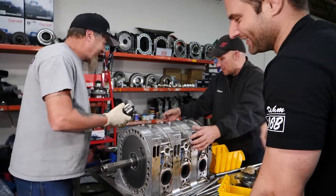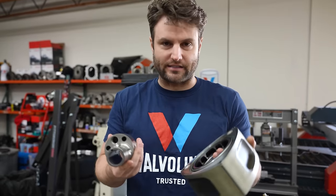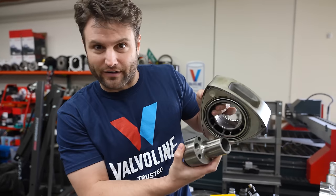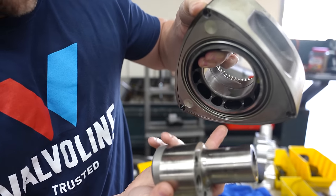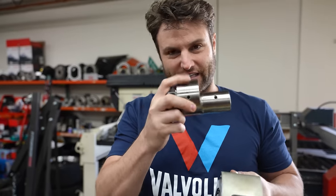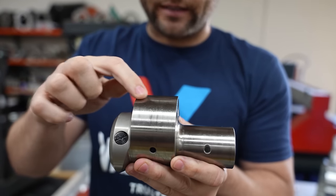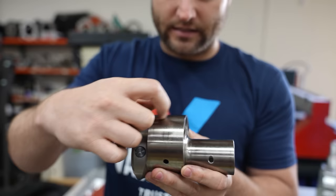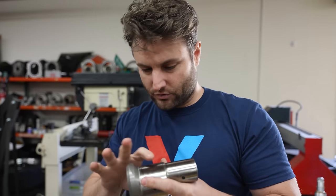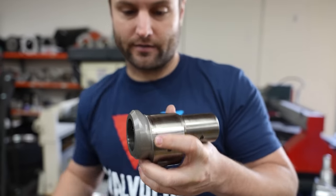When I chose to partner with Valvoline the relationship is obviously organic — I don't have to sell anything to you guys because the product itself is doing all the talking. Literally right here you can see what I call the 'alien blood' — which is what I affectionately call Valvoline's VR1 20-50 full synthetic. The reason I show you that is because this surface, everything is riding on this bearing right here. I can't show you more clearly than this — the rotor journal goes inside of the rotor, so roughly 300 horsepower is being pushed against this bearing.